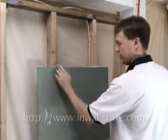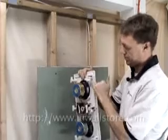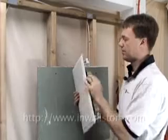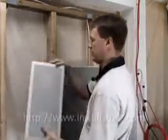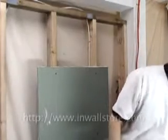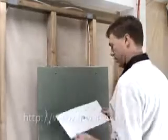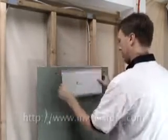So what has to happen is you take this outline here and you're going to cut over the top of this drywall on both sides. You're going to clip these off, these dog ears, all the way down to the base. And if you notice, this depth here still is going to be able to allow you to fit flush next to drywall because it's less than a half inch thick. So this is how we do it. We'll take our template that comes with each of these, and we stick it up here and we notice we're over the top, and that's okay.